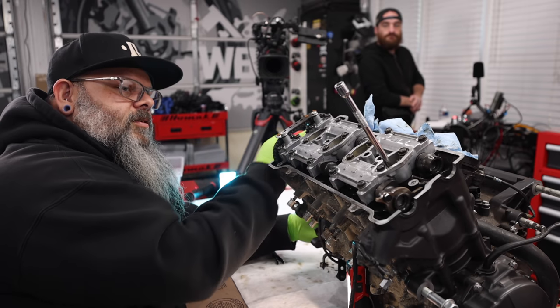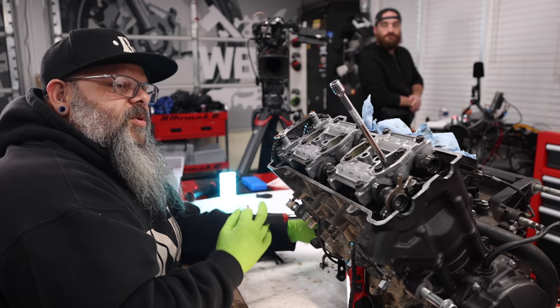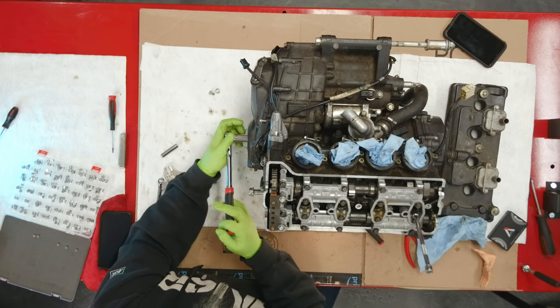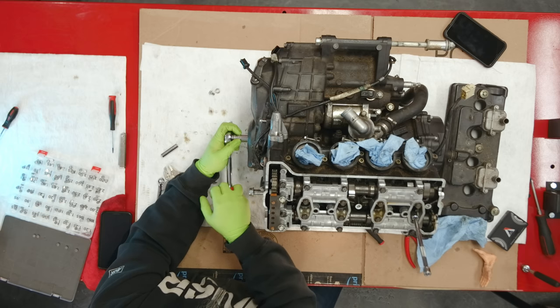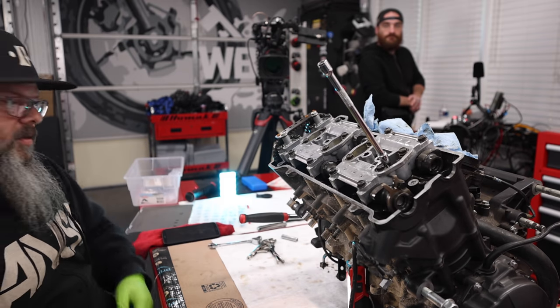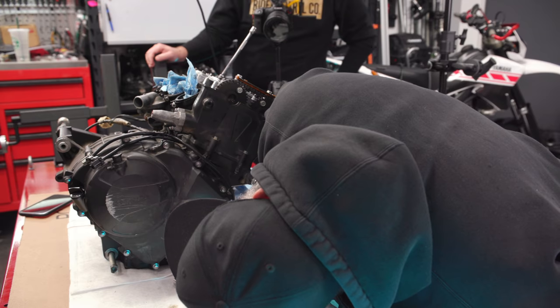That's a neat shot. So you really don't typically want to do this with a piece of steel on top of your piston. But the extension is very smooth at the end, and you could actually see where the piston will stop on the way up, right there. So that's where you know for a fact it's top dead center. And then if you come over here and you take a look, we're set.